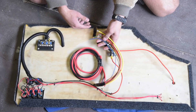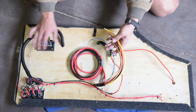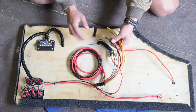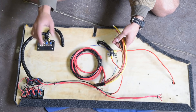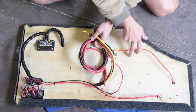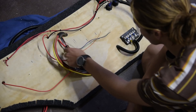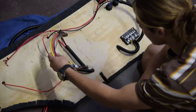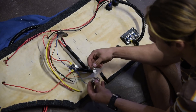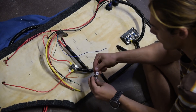We'll start by wiring up this BCDC charger first. I'm going to go buy another bus bar to make all the connections a little bit nicer, since we've got some thicker cables going on to thinner cables, and crimping is not really an option while soldering would be quite messy. I've drilled a hole to get rid of the Anderson plug cabling to make it neater, and I picked up connectors to connect lugs together for a cleaner result.